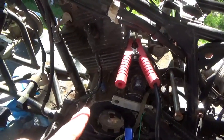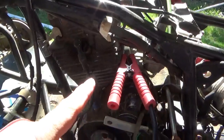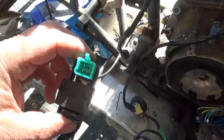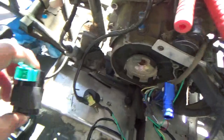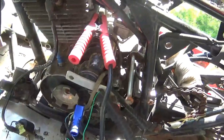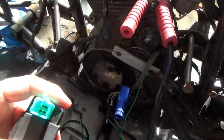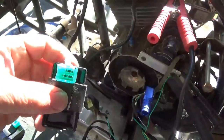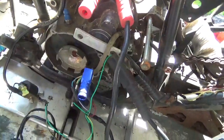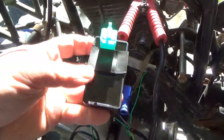So if you take this DC CDI and put it on here to start and run at low RPM, this thing expects to have somewhat of a delay — if not, it's going to kick back and fight you, making it harder to start. If you use this on the wrong engine, you're going to have trouble: it's going to kick back, might break your starter and starter gears. So the pit bike CDI is perfect for this engine. Now let's say you're running this ignition system with the pit bike delay on your Honda that has the mechanical delay — I find it works on some engines. You can tell they're lagging a little at idle, you've got kind of a double delay, but they start, they run, they do okay.